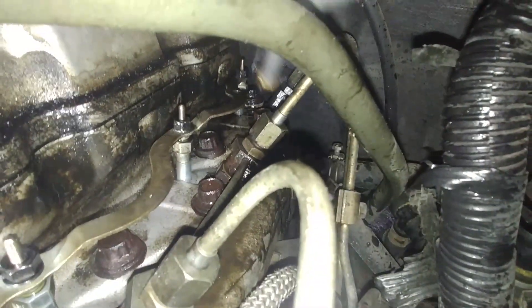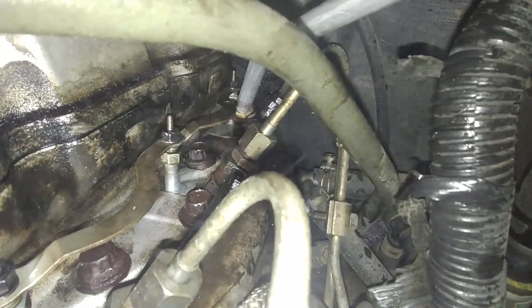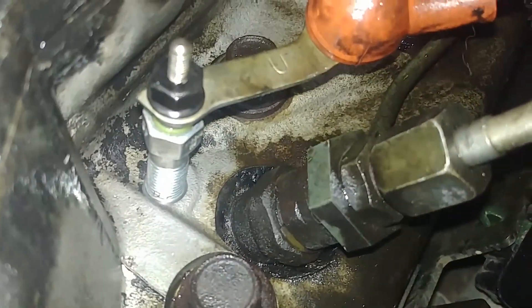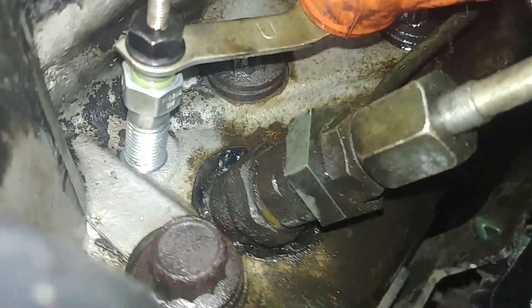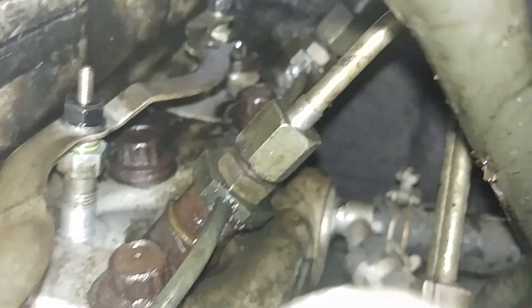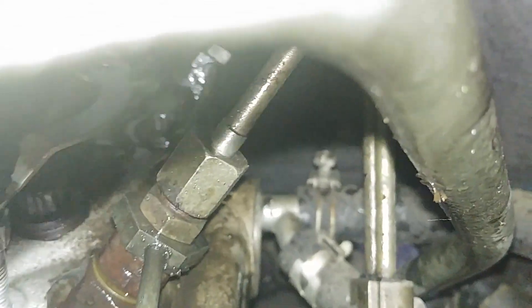Always do your best, take your time, and the result will be guaranteed. Now it's getting really clean — probably like never before. On these Delicas the valve cover gasket is a design flaw — they always leak because they can't be tightened properly and the rubber hardens up. Here we go — nice and clean, all shiny around the glow plugs. That's what you want to see.